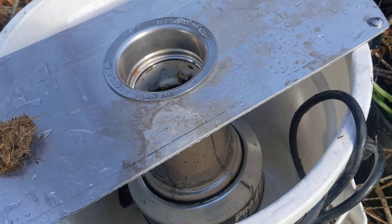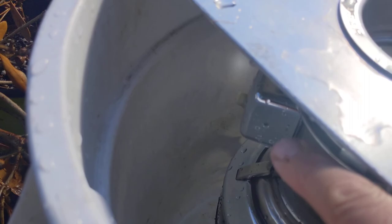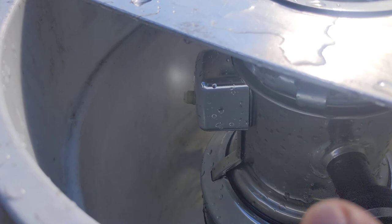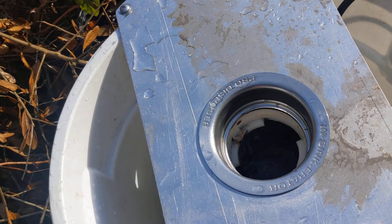My pulp machine uses an old garbage disposal that had a switch mechanism in the top that would lock, and you also had a switch so you had to actually close the top. That switch mechanism is right there, but it had actually failed, so I had to replace it for the house next door. This was going in the trash, so I just popped this little box off and bypassed the switch — now it just runs on a standard plug, which needs a switch.